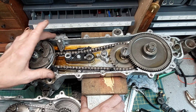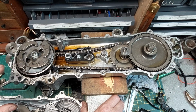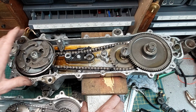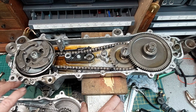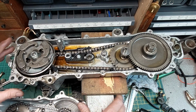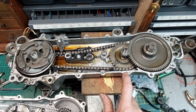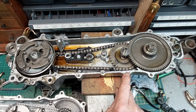And the more I go over this, the more I'm astounded at the engineering quality of everything, just for a simple little shopper hopper moped. Honda in their peak time, I think. So yeah, things we've learned. As I said earlier, you need to take out the drain screw because it goes into here, so it still locks the case.